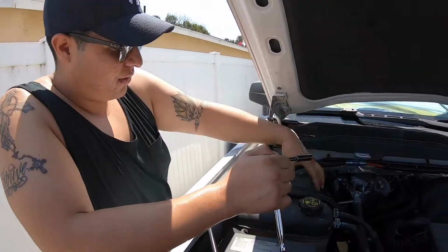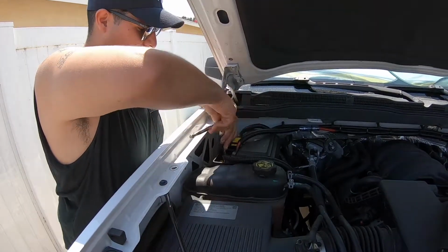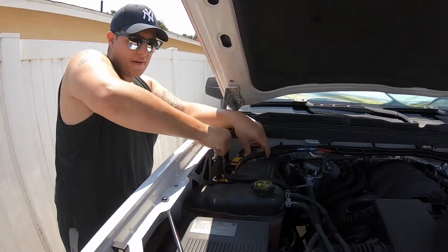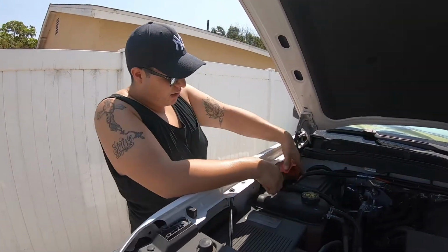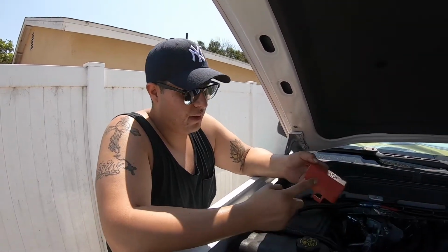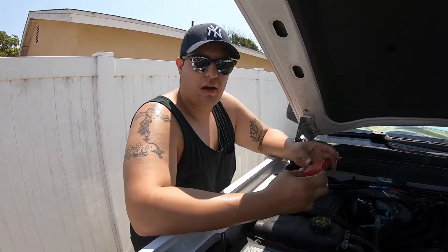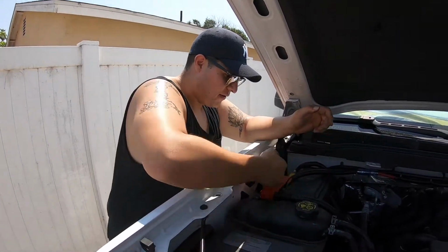Alright guys, so now you're going to do the same thing with the power side. Connect all your accessories back. Jeez, I can't even talk. Probably gets so hot. You tighten up the terminal. Like so. That's pretty tight. And you can run this little cover back. By the way, if you guys upgrade the battery, stock battery, it comes with these little covers for the positive side. Has like a little lock on it. I have a 0 gauge wire run into my alternator and a 4 gauge wire run into my amp, all copper by the way. In order to make that fit, I had to cut this right here, and now it fits nice and snug in.